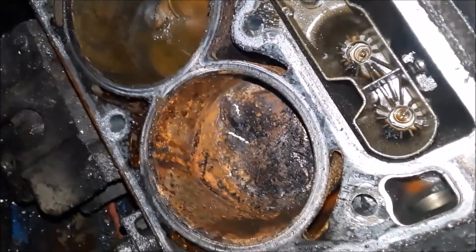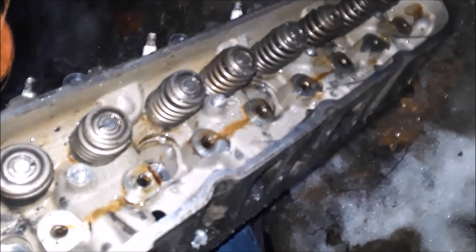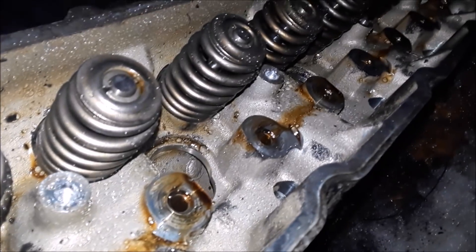This is a junkyard build. One of these cylinders actually had standing water in it. The camera definitely makes it look terrible. I'd say that's why she wasn't turning over. The heads look pretty good — I mean there's some rust on the valves and stuff, it'll clean up. You can tell how clean it is — like no varnish on this engine at all. I mean, it looks like brand new inside there. So before all this happened, this engine was practically brand new.